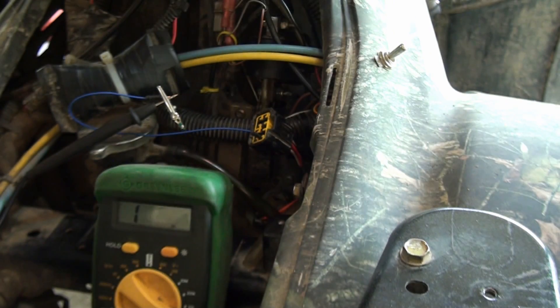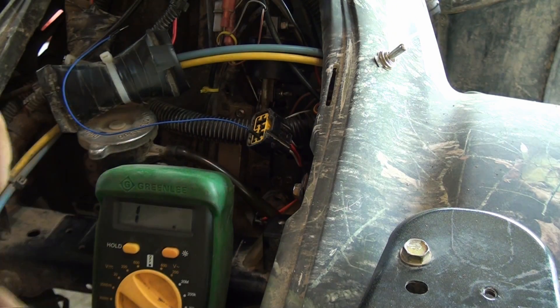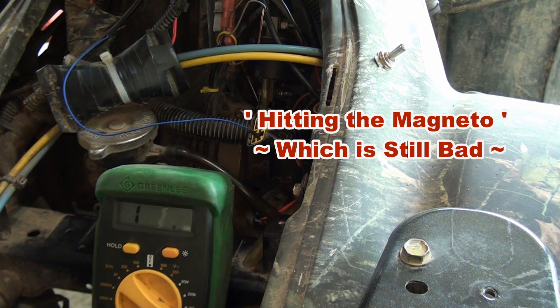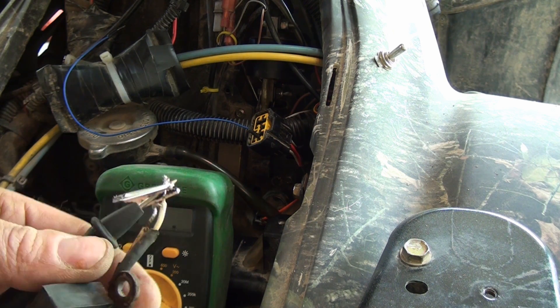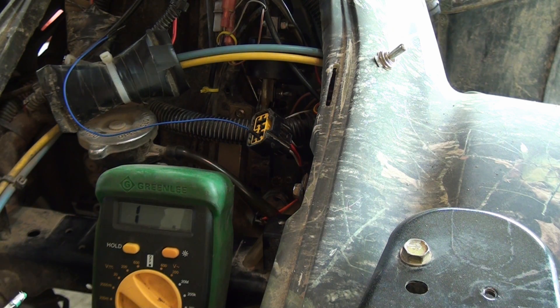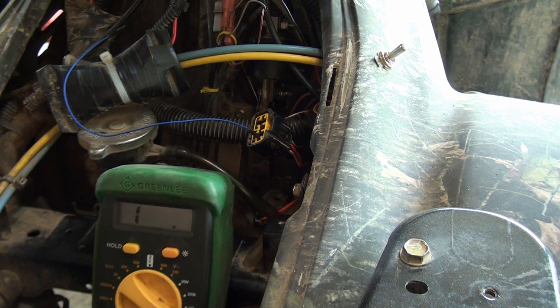That was the trigger coil test. While I've got it here, let's take a quick look at the old trigger coil. As you've seen in the video, it was actually hitting the stator — which is bad. When I tested the old coil, I was getting about 50 ohms, and when it was still in the machine it was reading like 28 ohms. That was the indication to start looking at the pulse coil.